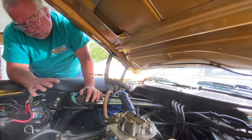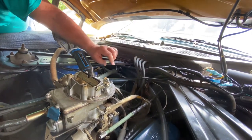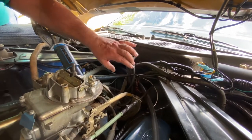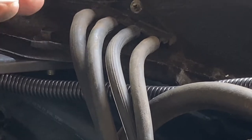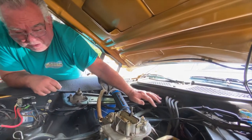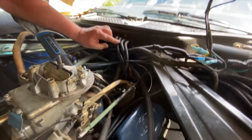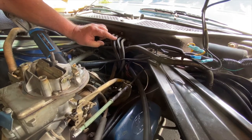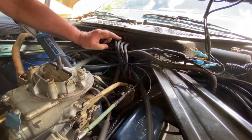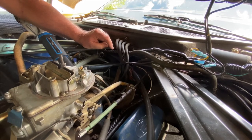On this particular vehicle, the vacuum modulator has two diaphragms: one for ported vacuum and one for manifold vacuum. The manifold vacuum diameter hose is a little bit larger than the diameter of the ported vacuum hose. On other cars, there's a single diaphragm vacuum modulator — you don't have ported vacuum going to the transmission, it's only intake manifold vacuum. I don't know right off hand if anyone bothered putting a two-port vacuum T on the manifold or not; it could be that the rubber hose leads directly from the manifold to the steel vacuum tube for single diaphragm modulators.